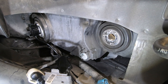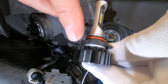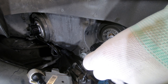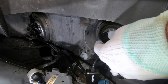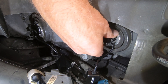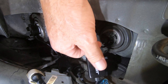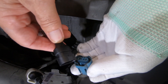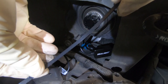Now let's go ahead and do the other side — the high beam, the 9005. There's your tab; your tab's going to go up but yet it's going to go at an angle. As you can see, it fits right in there again. It's at a slight angle, and then we're going to push it with our other hand and turn it clockwise — again you'll feel it seat. Now let's take that connector and plug it in. You'll hear it click when it's all in. Perfect, we just got two LED lights in now.